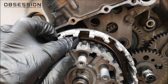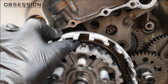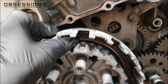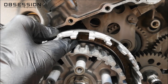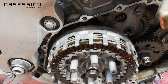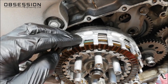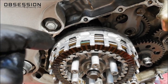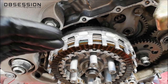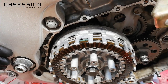All the way down at the bottom of the stack is the last friction plate, which is now a different diameter to the others, and the two anti-judder plates — the sprung one is nearest me, and the larger diameter one points outwards. Now I can put the rest of the plates back in. The plate that goes on this end has a little green marker on it if you're using genuine Honda clutch plates, as does the one at the other end. That's because they run half on the steel intermediate plates and half on the aluminium pressure plate, so these ones are a slightly different material so they don't wear the aluminium pressure plate as much.